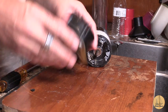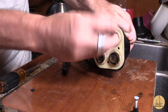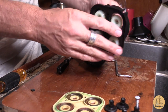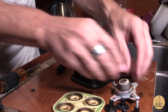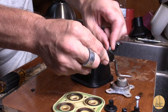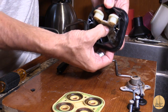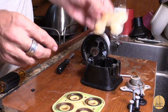So what we're going to do is disassemble this. The screw is connected to this piece here, and this is what holds the whole thing together. Let me get all these off of here real quick. Take the diaphragm off — I'm going to keep it in the same order so I know how it goes on there. We're going to get all of these screws too, because we actually don't need those — they are in the rebuild kit, but we'll hang on to them just in case. This piece inside here has a crease in it — you have to bend this a certain way to be able to get it through. We're going to fold up one side so that we can ultimately get this out, and that's important to note because we're going to have to do the same on the new one.